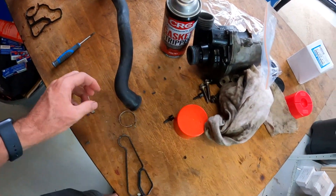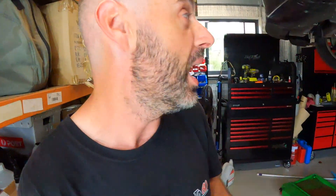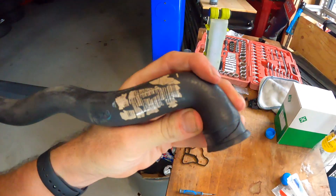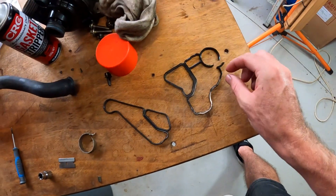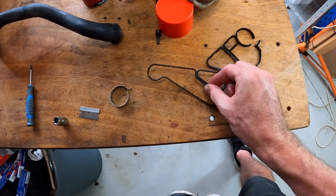I didn't want to cut that, so I was originally going to fit the entire hose from the parts car — it's in pretty good condition. I literally spent a good half hour trying to work out if I could get that hose off the thermostat, ended up giving up, and what I've done to try and speed things up is cut the metal band off that hose and fit a hose clamp. So it's got the original hose but with the new plastic end. I am going to need to order an aluminium one because the plastic one off the parts car probably won't last very long either. But it does seem to be sealing. Now the main oil filter housing gasket — I reckon this is where most of our oil was coming from. This gasket has gone hard and brittle, you can see it's cracked as I pulled it out. What I reckon happened is somebody had a go at changing it and couldn't get the actual housing off, so they just did the oil cooler gasket.